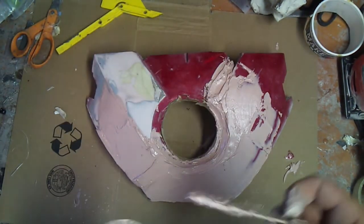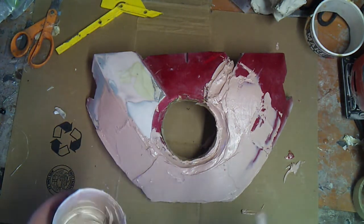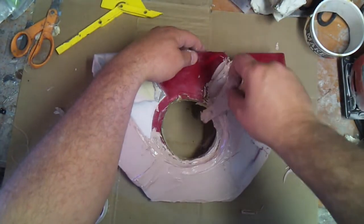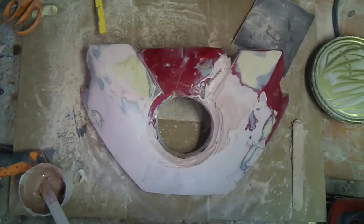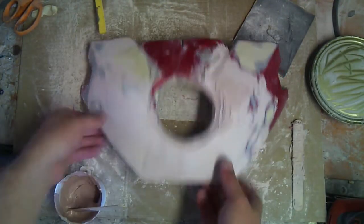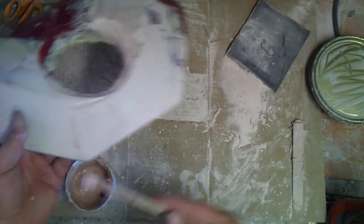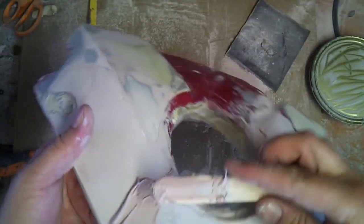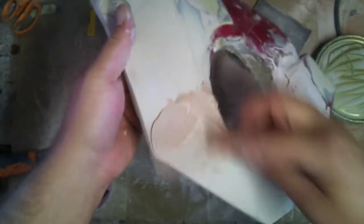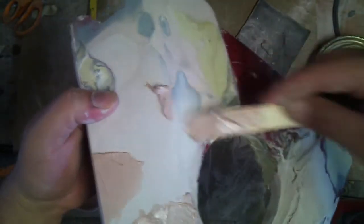So that'll about do that for now. I'll have to go back and obviously add some more, take some away. But for now, it's starting to get rubbery a little bit. All right, so that's after a little bit of sanding. We're going to add some Bondo here. You can see there's some spots, like right here, that need some Bondo. So I'm just going to put a little bit on there right now. Some right there. So basically any low spots, I'll have to hit it back up with the sander again, but that's okay as long as it's smooth after it's done.